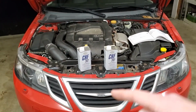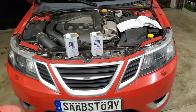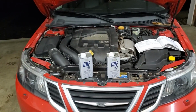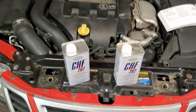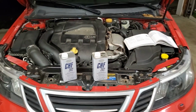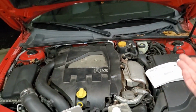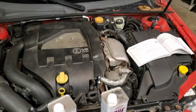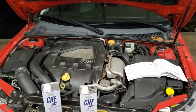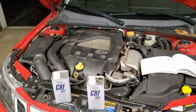There's a lot of aftermarket versions of it. However, they're definitely not as good as the original equipment. And then also the power steering rack and pinion underneath the car is also not a fun job and can be pricey. So the easiest thing to take a stab at first is just to flush the fluid. Regardless of power steering fluid, brake fluid, coolant, you name it, all these fluids within this engine and the braking system and whatever else, they all have certain intervals, whether it be a couple years or X amount of miles, they recommend flushing and replacing.